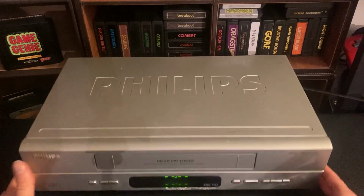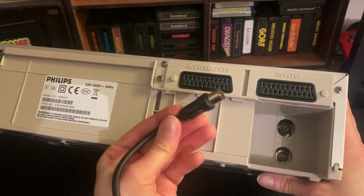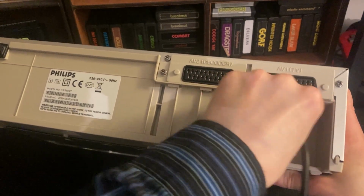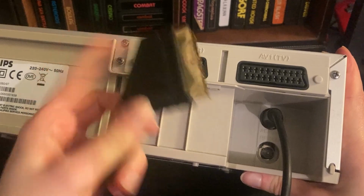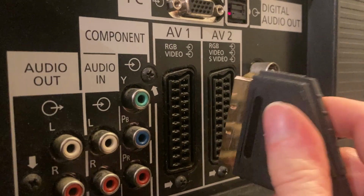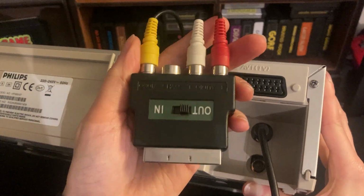One much easier way to do this would be to use a VHS video player or a compatible DVD player that can accept the cable input. Many of these can auto-tune to produce picture with a lot less hassle, and then you can also output from this device using another cable like SCART. This won't actually make the picture any better, but it will allow you to plug it into a TV without coaxial input.